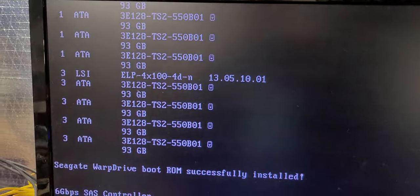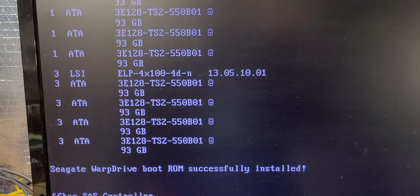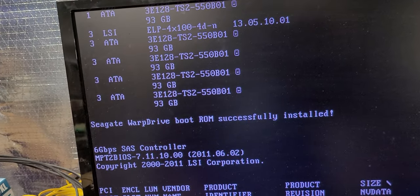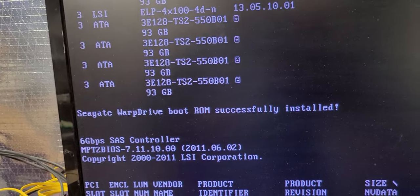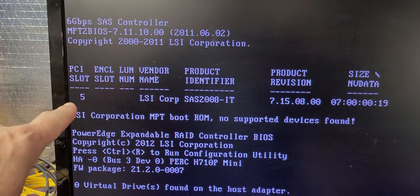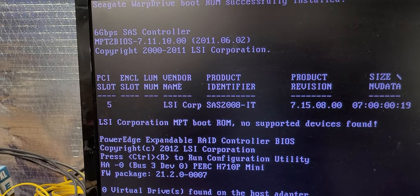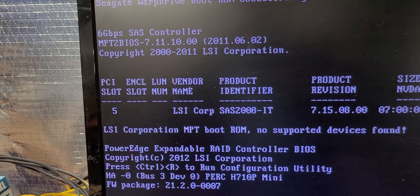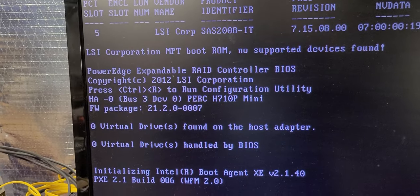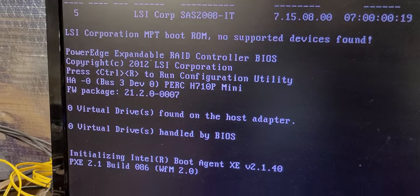We are now going into the boot post mode. And if I built out my boot image, which will either be a showstopper or it will be just what it's going to be, we will know pretty much exactly what we need to do. And as you noticed, there's not a single hard drive coming up under the LSI controller. I like the LSIs because they're flexible. They have ease of work between SSDs and SATAs and SASs out there in mixed mode as well as isolated mode, as long as you properly channel them in the actual disk arrays themselves.